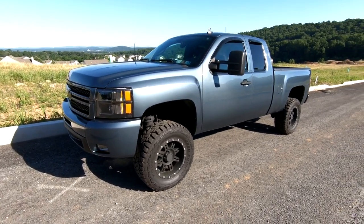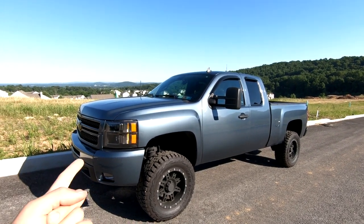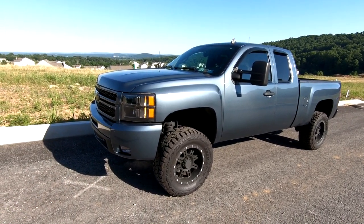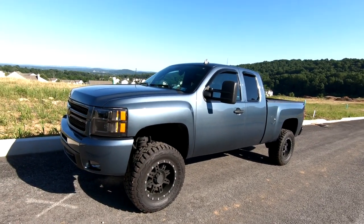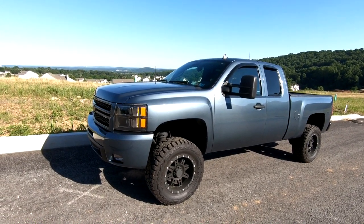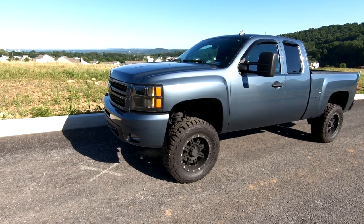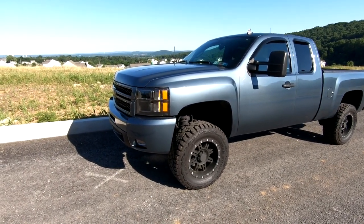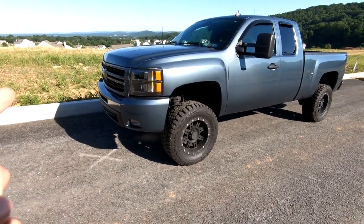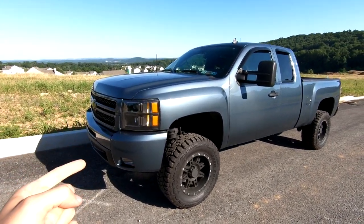The one thing I did upgrade — and this is something you can and should get with the kit if you're buying it — is the Rough Country upper control arms. Within 30,000 miles, the only issue I had was a squeaky ball joint. You could tell it was all dried out because you can't service them, and I definitely caused premature wear by not getting the upper control arms that you can actually service and grease.